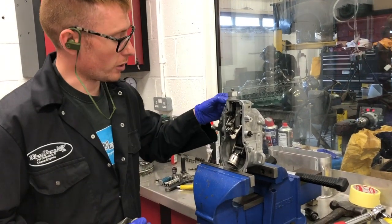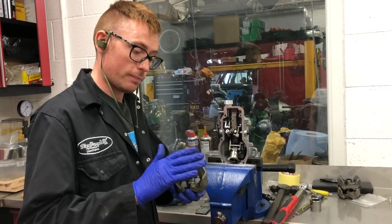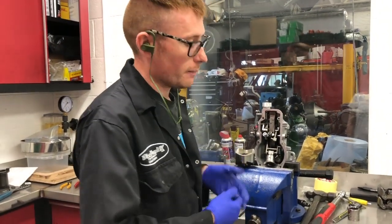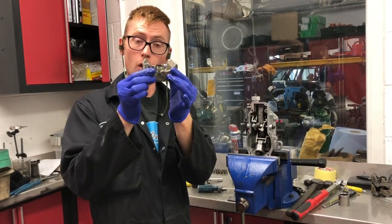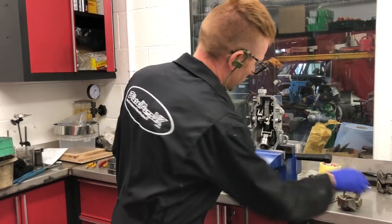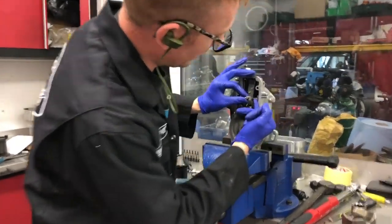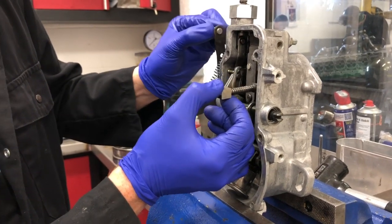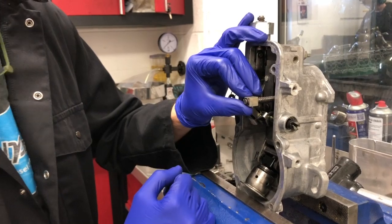When you rev up one of these pumps, it's not a case of you just literally pushing that and it moves the throttle lever and it moves the fuel rack. It actually kind of bounces off the position that these flyweights are acting on, and that is kind of what the Governor system is all about. Because if you think about it, without that, what would happen as the RPM increases — it wouldn't stop and it would continue going up and up and your engine would explode. To combat that, obviously as the RPM increases, this pushes out more and more until it gets to a sort of plateau point where it's pushing so hard against this that no matter what you do with the throttle lever, it's not moving the actual rack. You can see this is what actually moves the rack, and when there's no pressure on that, it moves fairly freely. As that pressure increases, it pushes that back and stops the fueling from being able to be increased with the throttle lever.